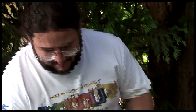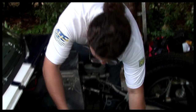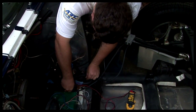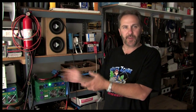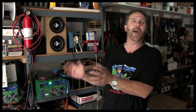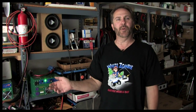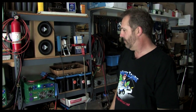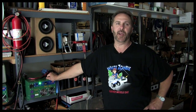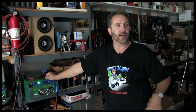You're at 360 volts. So what we're dealing with here is that we can set it all up for a certain car — it's not that big of a deal, but you have to adjust things. I got this all set up for my car and I don't want to reconfigure it. You can use it on any voltage you want, but if this is higher voltage than what you're charging at the way it's set up, you just have to keep an eye on your gauges. When it starts coming up too high we can turn it back down. You can blow the batteries up — you can destroy the battery pack if you get carried away and walk away and forget about it. But if it's set up properly it'll automatically shut off.